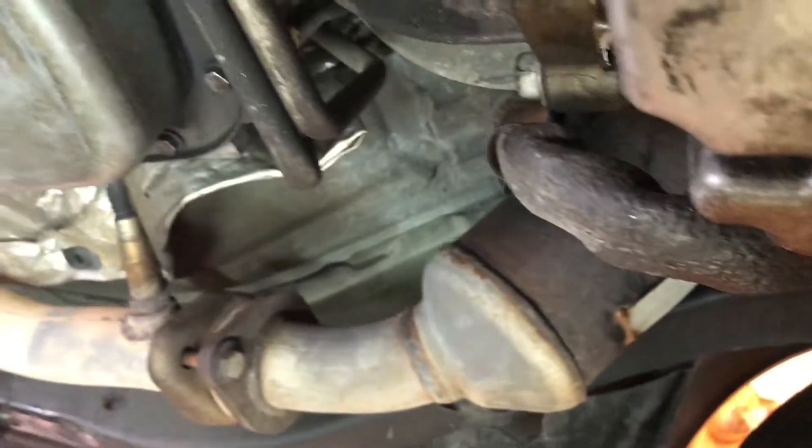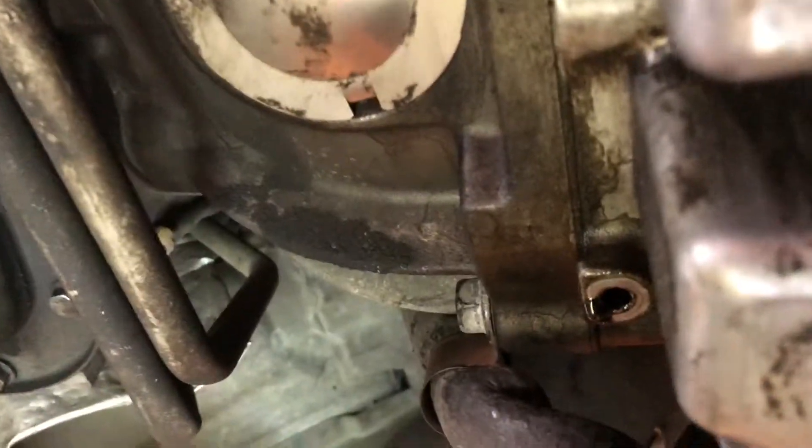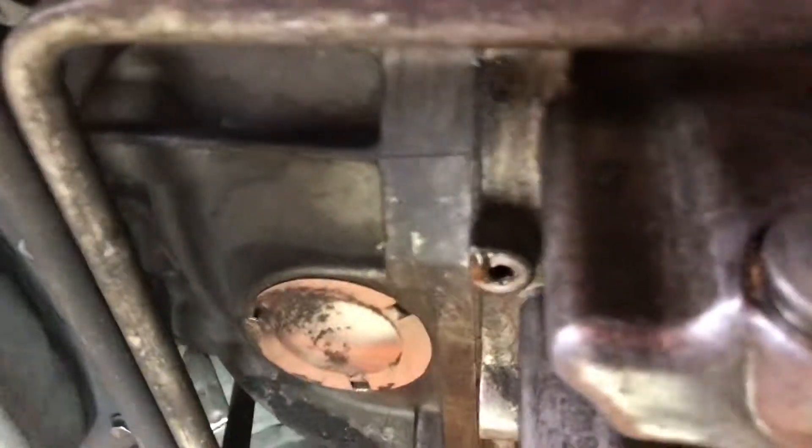At the oil pan, you'll be able to see I pulled the bolts already. There are four bolts that run along the sides of the pan, then there are two long ones right here by the transmission, and then back here on the transmission they come through and catch the oil pan — two on this side and two on the other. You're going to pull those bolts out, then the pan should have enough room to drop and be levered out of there. Let's get those last four bolts and get this pan out.